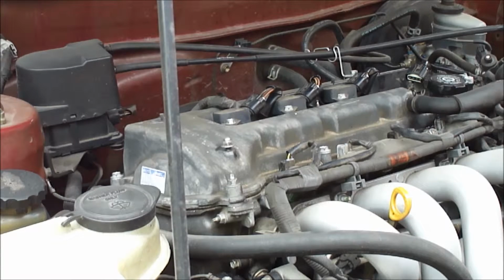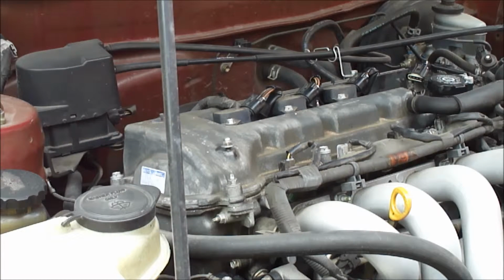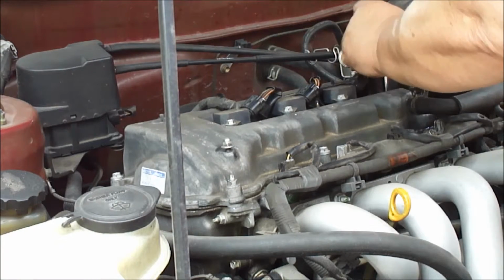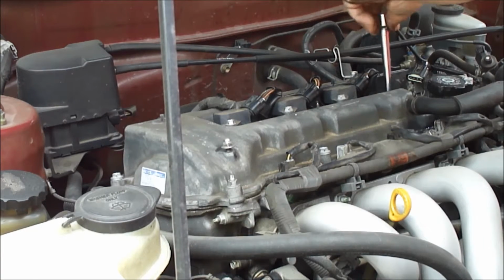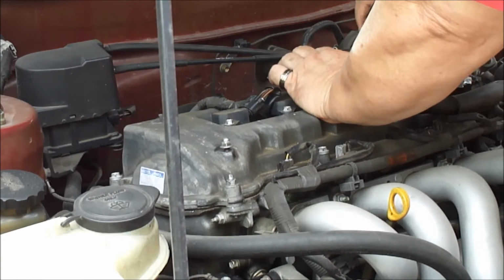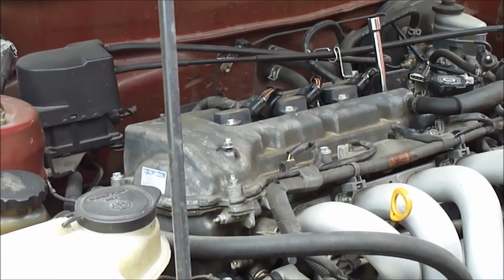That one looks the same. They all look about the same. So it's not boding too well, thinking about the code of it missing on a cylinder. See? Interesting. Bad plugs, yeah. They said 100,000 miles, and these are at 155. For what? The manufacturer's at 100,000 miles on the original plugs, and this is 155,000.